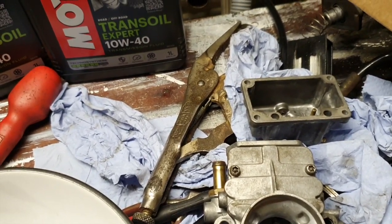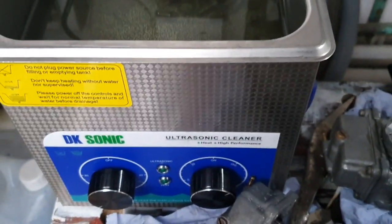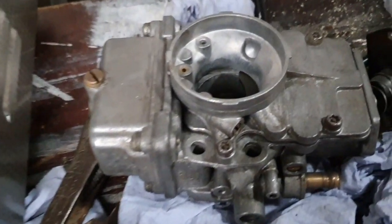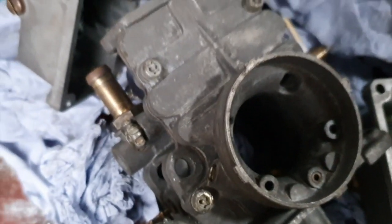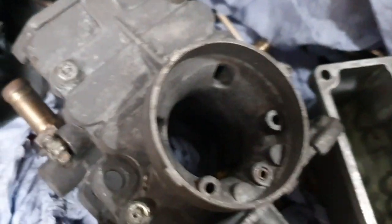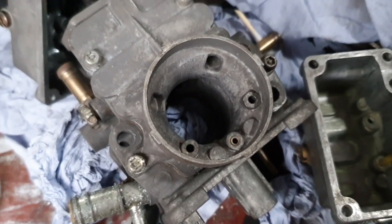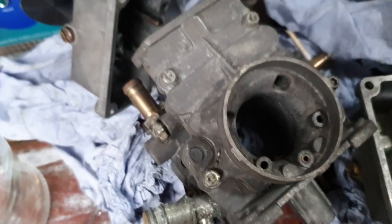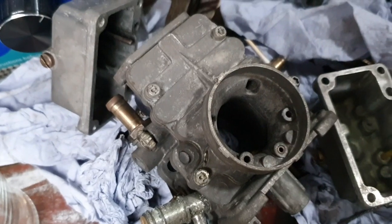One little point I'm trying to solve: I've been using my ultrasonic cleaner and it's been working quite well on these carbs, but I used a gunk solution — not with heat or anything — and it's actually made this carb really gray. So I'm going to try a different solution tomorrow; I've got some baking soda coming and I'll use that to try and get a bit more gloss on that one.